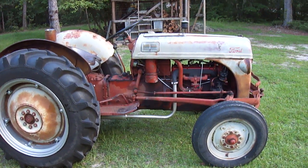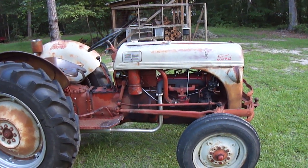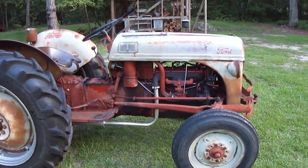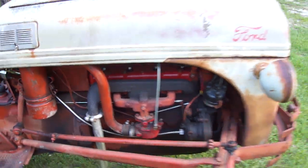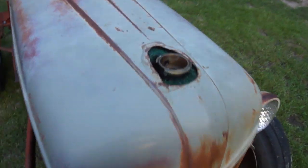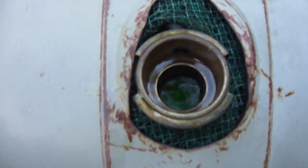In the previous videos I was getting combustion gases from the head, which I suspected, into the cooling system. I replaced the head — I've got a new head installed. It all ended up good. I retorqued the head after it cooled off, and now I do not have any more combustion gases coming in through the cooling system.